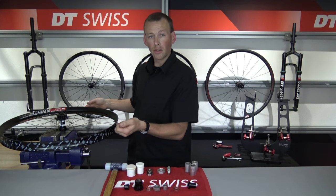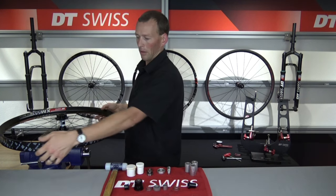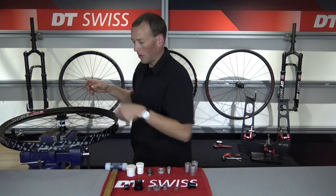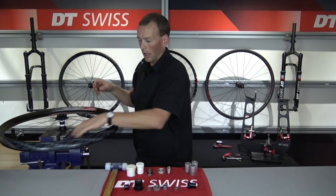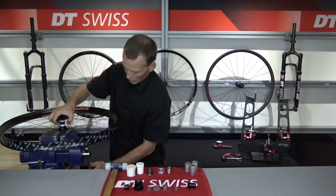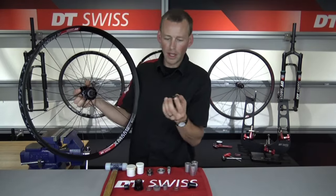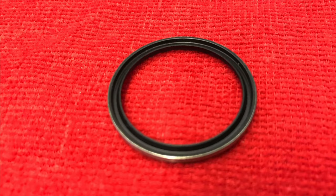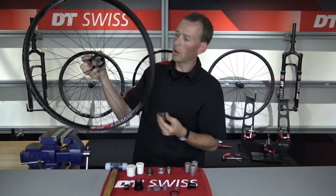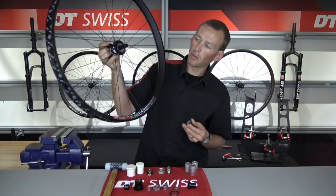You might require additional assistance. This wheel is brand new, so it's going to be very simple to remove the ring nut. A big left-hand turn and you'll see the ring nut break free, and then there'll be a little bit of resistance. That resistance is the actual ring nut extracting the hub seal. Once that comes off, I'm going to spin that out, and now we can remove it off the tool. We took the ring nut out, and we have the drive side bearing exposed and ready to be removed.